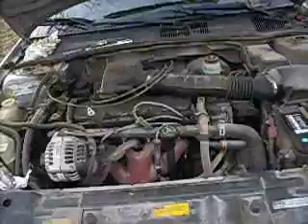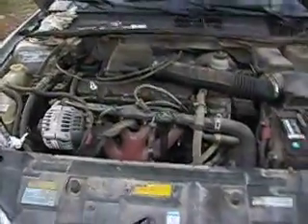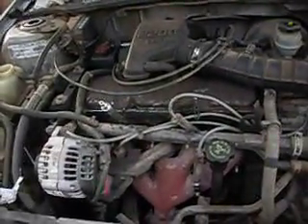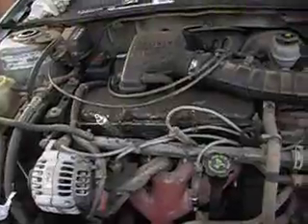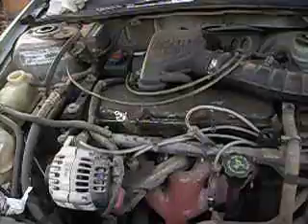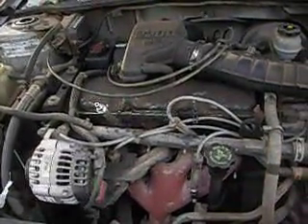That's a pretty run-of-the-mill way of diagnosing a blown head gasket. Of course, if you can get the engine to run — which this one wouldn't even start for me — and you put coolant in the bottle and it's running and chugging away with compression gases coming up out of the bottle and coolant coming out of the tailpipe, well, that's an obvious no-brainer. But in the case of this car, it won't even run — it didn't even try to start. So yeah, blown head gasket, and that's basically where I stand.